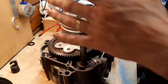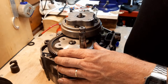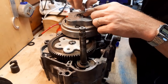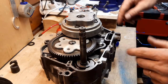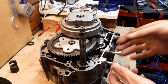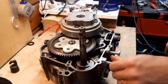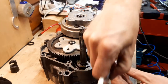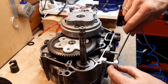Now we're ready to put the cover back on, but I'm not going to do that yet. I want to assemble the other side first. I'm also going to secure this piece because it tends to fall out very easily. Now we're going to turn the block on this side and build up the opposite side — the ignition and the distribution. I'm putting two 8mm bolts in so I can grab it in my vise, with the engine upright as it sits in the frame, making it easier to assemble the cylinder, piston, head, and all.